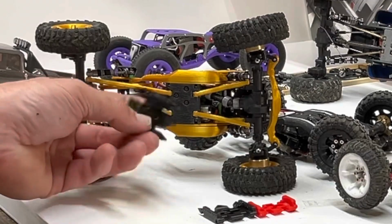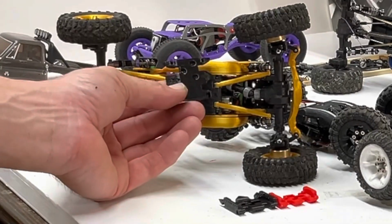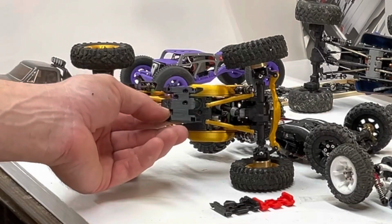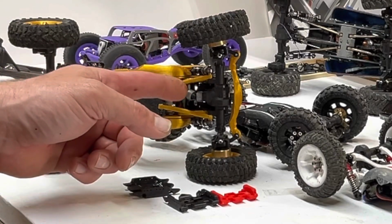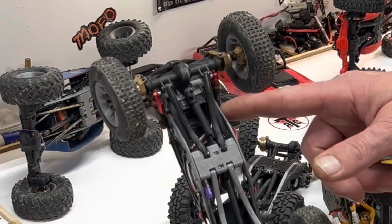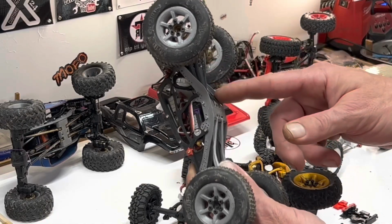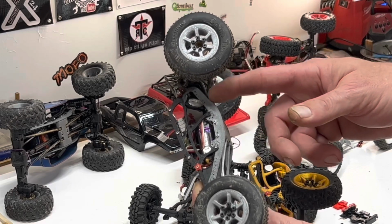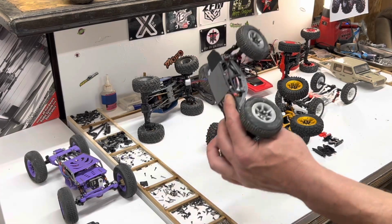By the way, this is how it goes. It's like this, the star goes to the rear. Cool fancy star. But we were running obviously with the 18P transmission and skid, the 18P link set that I made. So then I made the link set that I had on the black buggy, the JLU rear lowers as front lowers, and the deadbolt front lowers as front uppers. And so I really liked that link set. So I made it and I put it on here.